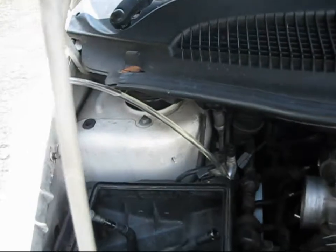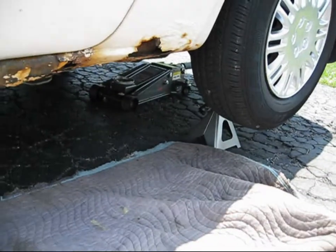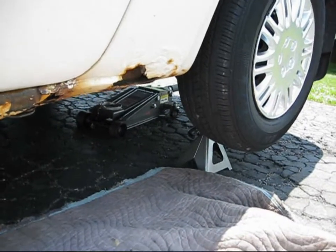My fuel pump has run dry. Both front wheels are chocked front and back, and the back of the van is up on jack stands. Don't take a risk — don't work using just a hydraulic jack. Put it on stands.